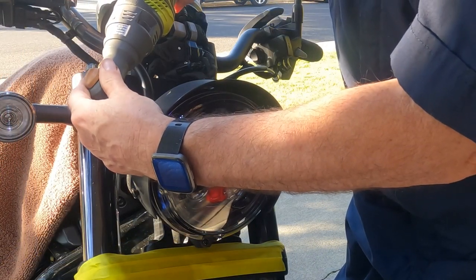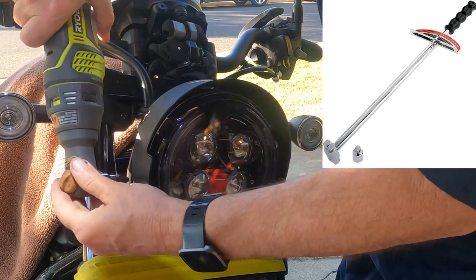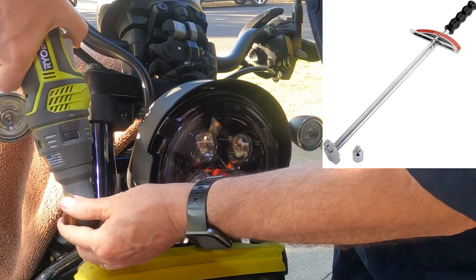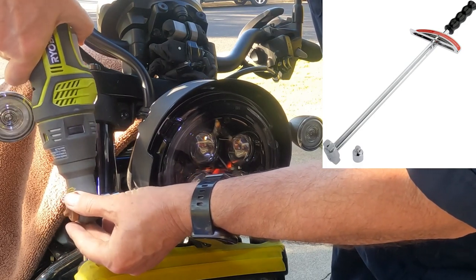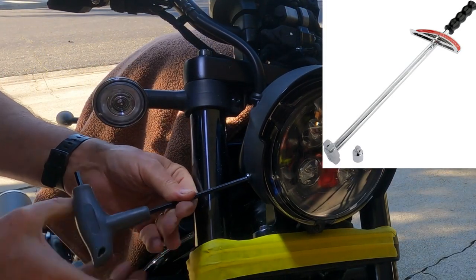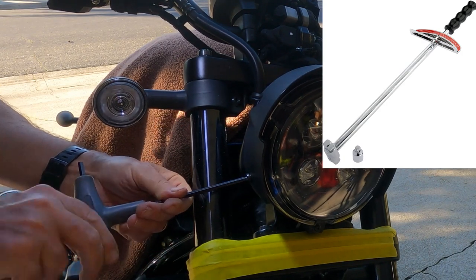But here's an intriguing irony. A $25 bar-type torque wrench can measure torque continuously from zero to its maximum rated torque. Although I suspect that for most cheap bar-style wrenches, achieving an accurate torque at 1 newton meters, or 0.74 foot-pounds, probably is not realistic.